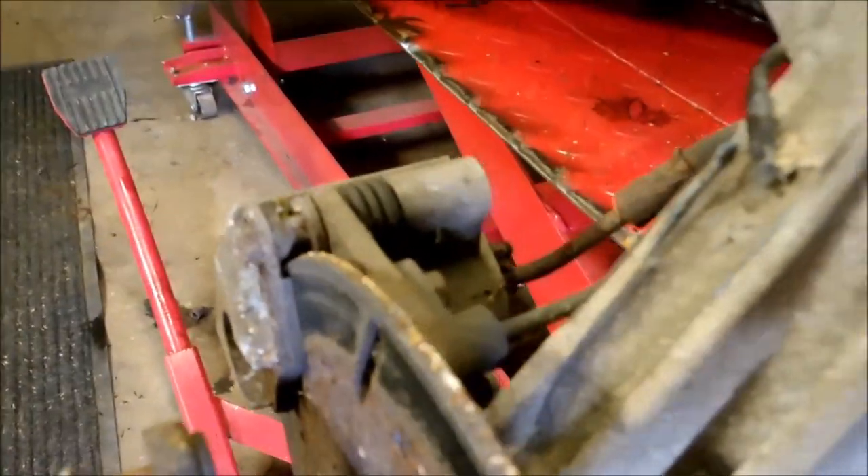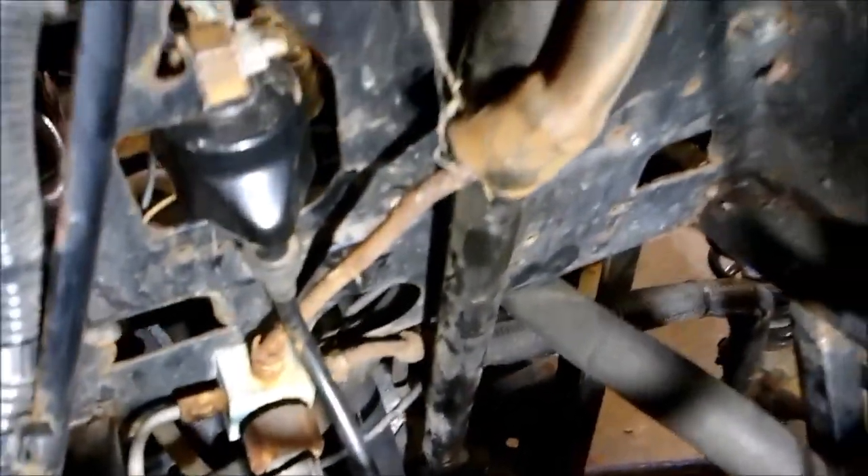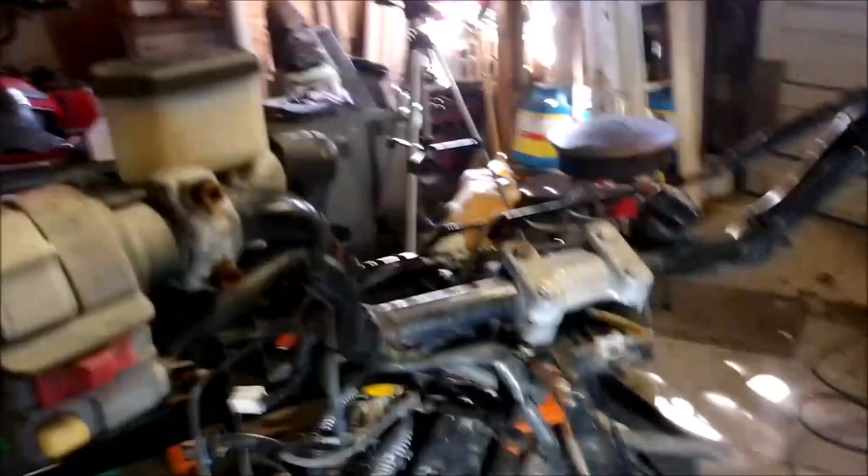Next step is brakes. Got the tire off — the brake pads seem to be in fair shape but I do have a brake pad set. Another thing missing is the brake lever; I don't know how this guy stopped — he must have used the back foot brakes. I'm going to replace it; I have a used one from a buddy of mine who parts these things out. The brake line goes all the way down to the junction box and it's all pretty rusty — that's probably why it didn't work. I'm going to rip that apart, take the screws out, replace it, and then bleed the brakes.